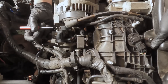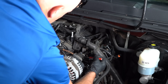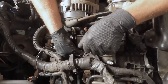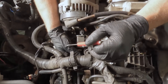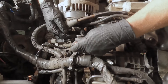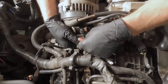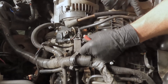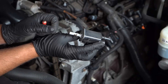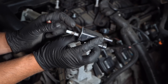The valve just opens and closes. When you have power and ground going to it, it's going to open the valve, and then when the power goes away, the valve is going to close. We'll just disconnect the connector — this is a very easy repair. You can use a straight blade screwdriver to disconnect the hose. There's a little bracket here — you just bend it a little bit and it slides up, and you can disconnect the hose here or over there. Just a little tab you move, and there's the valve. This should be closed at all times, so if you try to push air or suck air through it, it should just be closed and not allow any airflow.